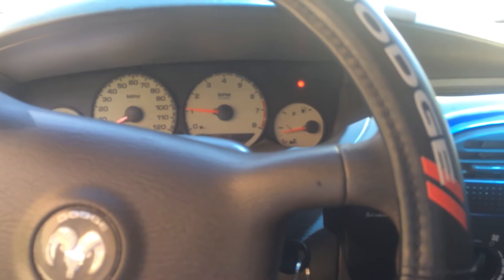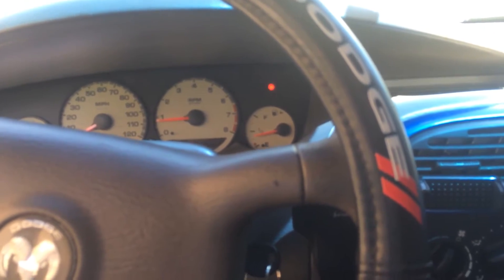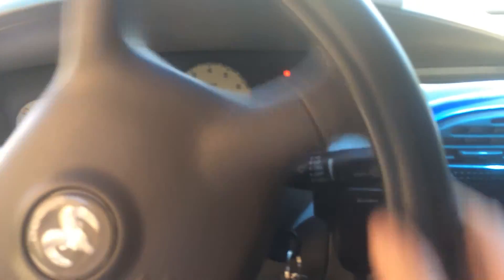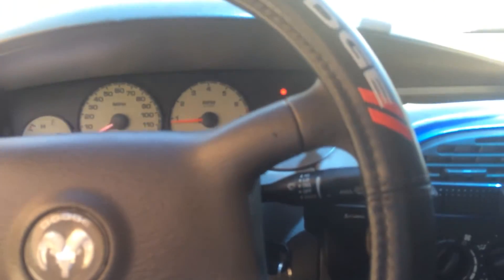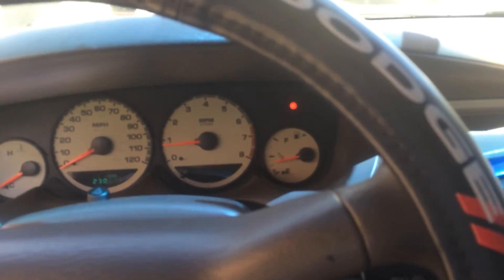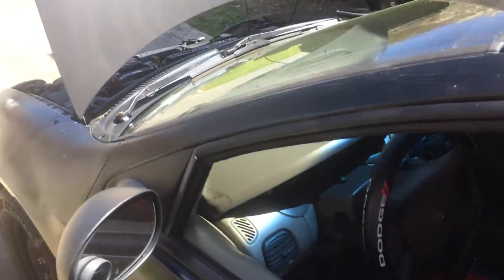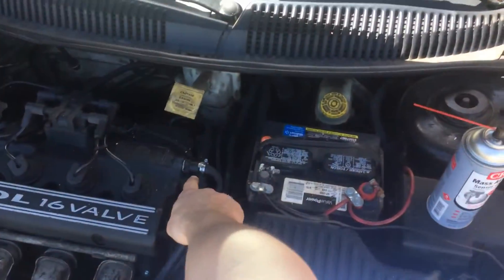Got that belt squeak — that's actually the power steering. One of these days I'll fix it; it still works. The power steering is the next thing to work on. But other than that, doing pretty good — idling good. Turns out, that was my PCV leaking. A bad PCV. I mean, I've replaced so much stuff on here, and it was the PCV the whole time.